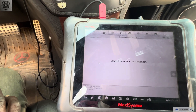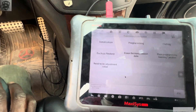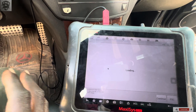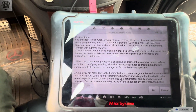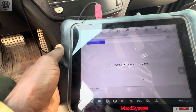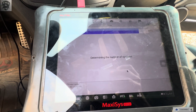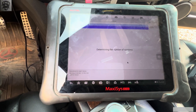What I'm going to do now is perform online programming. Click from here — let me turn my Bluetooth off. Now I click on 'Initial', then click on 'Manual Initialization', so that it will pick from the already filtered data. The new control unit is already plugged in. Click Continue. We understand everything, so we will proceed. It's done.